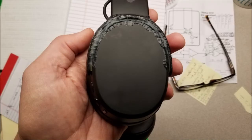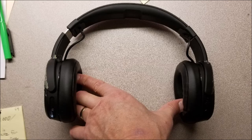Regardless of how they look, this epoxy material bonds the plastic and sets up very hard. You'll know when you feel them afterwards that the ear cups are solidly in place. If you have any doubts about that you could always do the other side of the cradle as well. I just did the outside edge and that seems to be more than enough. You can see the bond is strong and the headphones are mechanically sound even though the cradle plastic was broken all the way through.